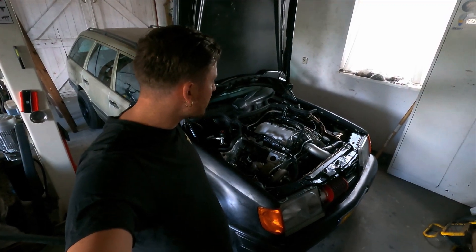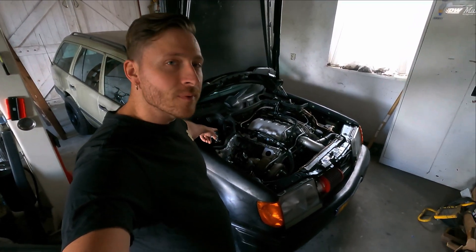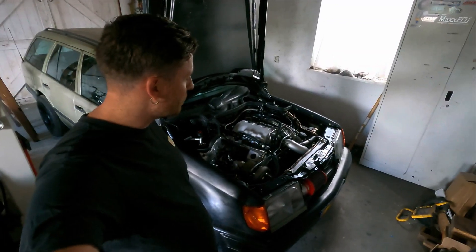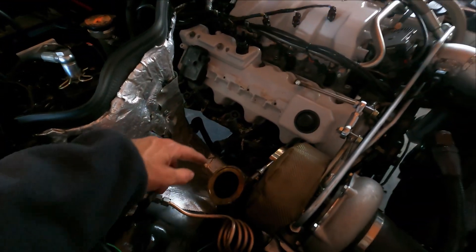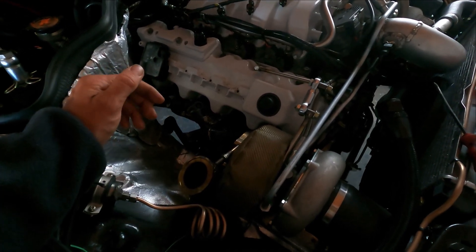So that's where I'm going to start - dismantling stuff. First I'm going to lift it up to get the downpipe out, and the lambda sensor out, and then from there. Downpipe is removed. Also got the wastegate removed - otherwise I cannot remove the downpipe.